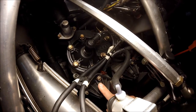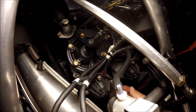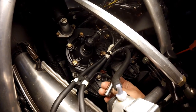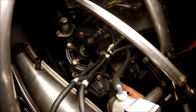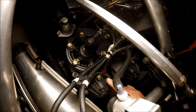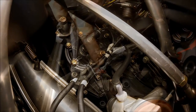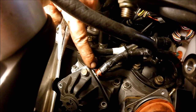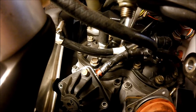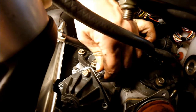There's one on each side for each cylinder. Each one has four bolts that hold it on. It's a 10 millimeter head. You can use a deep well 10 millimeter socket or even a ratcheting wrench. You can see this hose going into the exhaust valve housing right here. This needs to be removed on both sides. There's a little clamp right here. Just use your needle nose and pull that up out of the way. You should be able to pull the hose just off. They're a little stiff sometimes.